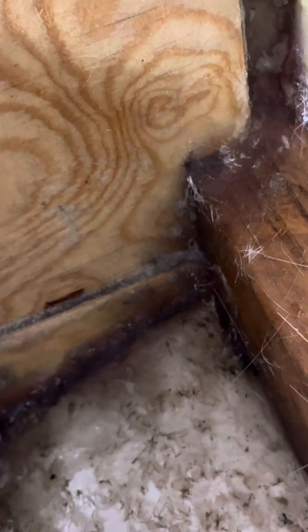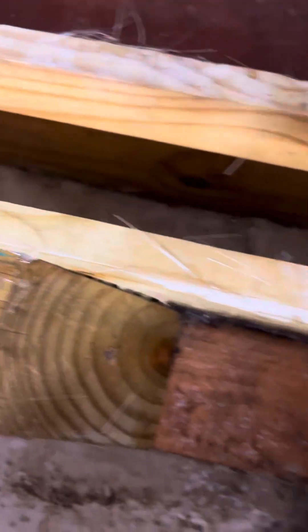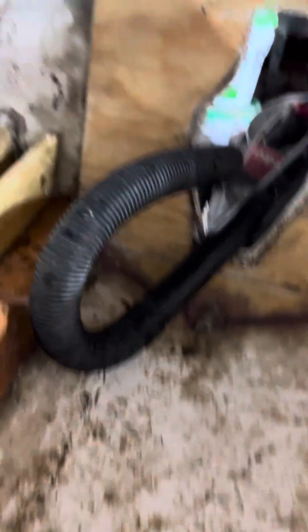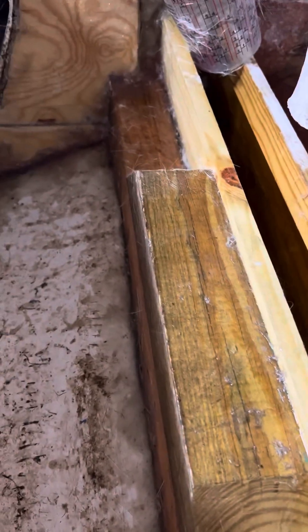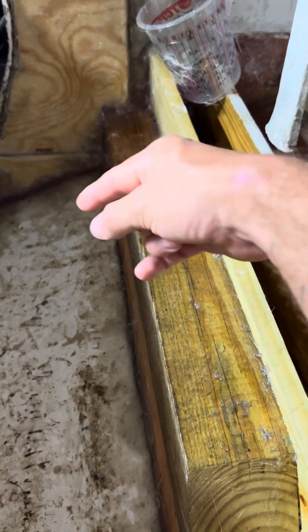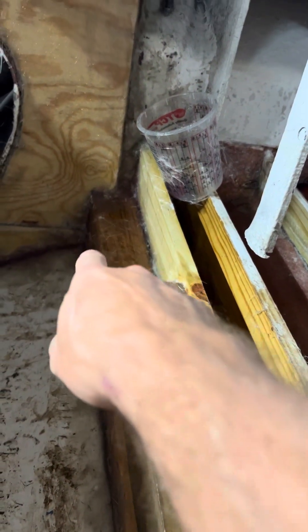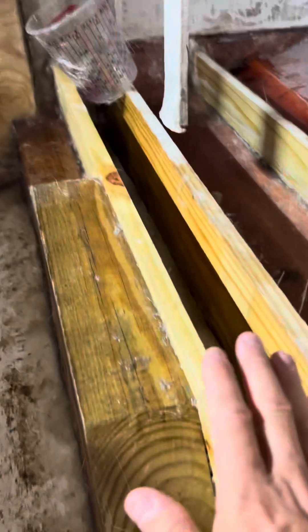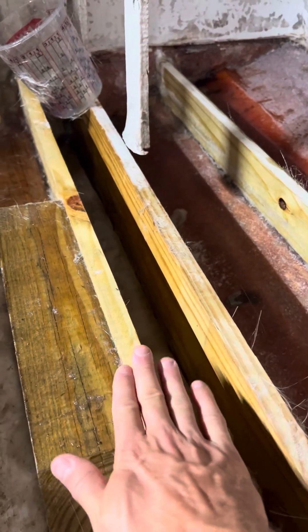You can see right here I've started in all the tabbing, all the way down here. Right at the engine mount, what they originally wanted to do was this piece right here — down at the bottom it had a hole. This was an open and exposed area, and water could get in here and it was allegedly just to drain down there. Problem is, where they had the hole sitting back up by the transom, it was just an open invitation for water to get behind the fiberglass. So we simply eliminated that. Put a piece of wood here. When I put the floor across now, it'll come right here, get glassed down and then back around over the engine mount system. You can see it's tabbed in on both sides, down here in the corners, and then it comes in for the drain.